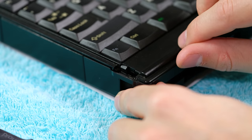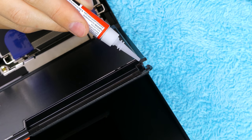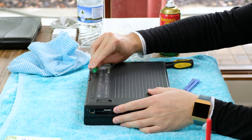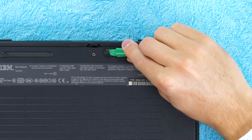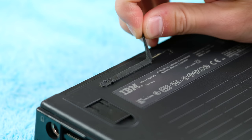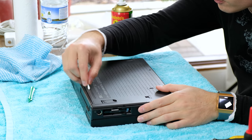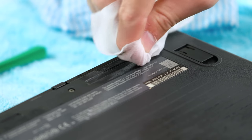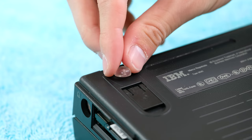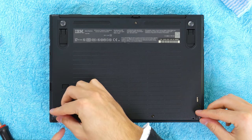One of the latches that holds the keyboard assembly in place also needed to be repaired — a piece of plastic had broken off which I found inside the laptop. With a small amount of super glue I put it back in place. After letting the glue dry overnight I began to remove the rubber feet that had started to melt. This is actually pretty common with old electronics — over time they literally just melt into a gooey sticky mess. I eventually realized you could remove them in one piece if you pulled up the adhesive tape holding them to the laptop. With both feet removed I cleared up the leftover gunk, and after some hard scrubbing all of the melted rubber was gone. I gave the base of the laptop one last wipe down before installing some new feet — soft rubber adhesive pads stuck on each corner. While they do look a bit weird, they are definitely very functional and are going to stop the laptop as well as the table from getting scratched up.